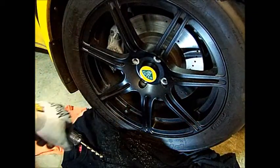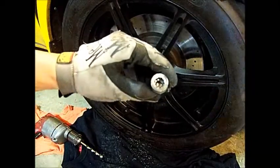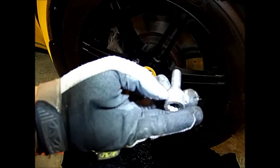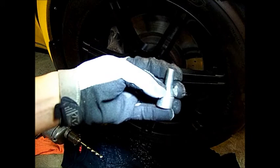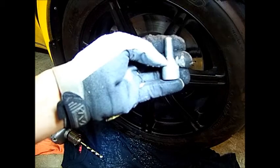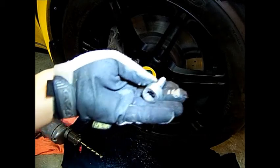You can see the pieces of metal coming out of there — I've got one removed. It might be a little difficult to see, but let me bring the light up. So this one is already drilled out and removed. What you want to do is get to the point of the shank — you can see a small hole there. That's drilling it out far enough so it just hits about this point. What happens is this whole area tends to collapse, and then when you apply torque from your socket wrench, it'll just snap and come right off.